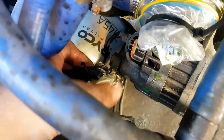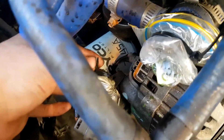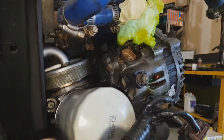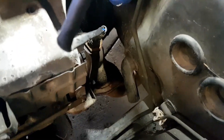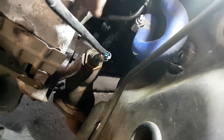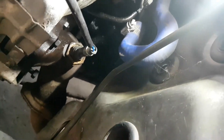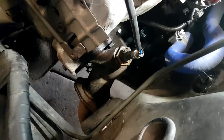Now I'm going to try and get this off — I'm not quite sure what it is. Might pull this back and see what's under here. Alright, so I'm not taking the oxygen sensor out. What we're doing is taking out these three bolts — one there, one there, and one there. And that disconnects it from the turbo so we can get the car out. Then that'll just angle there and the tranny shouldn't hit it, so we'll be good to go.